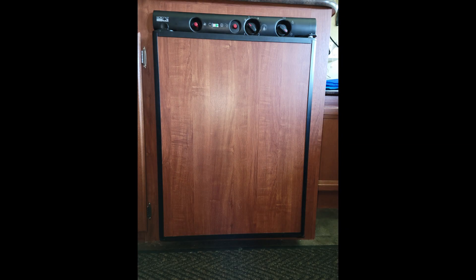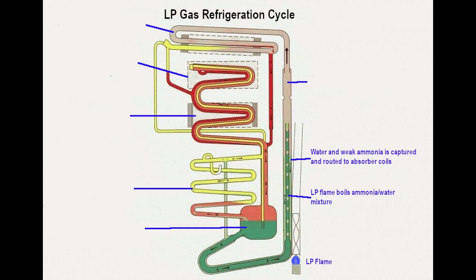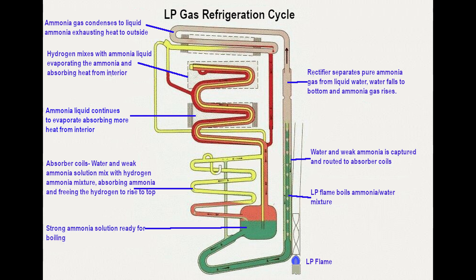Now let's get started. The refrigerator in my travel trailer can operate on either 110-volt AC or propane gas. It seems counterintuitive that you burn gas to keep things cold, but that's what makes the absorption refrigerator so special. The sealed refrigeration system is filled with a pressurized mixture of distilled water, ammonia, hydrogen, and sodium chromate. The heat from the burning propane is used to boil off ammonia from the water, where it circulates through a labyrinth of tubes, tanks, and heat exchangers, mixing with hydrogen while both absorbing and releasing heat. I'll put a link in the description to a couple of videos that explain absorption refrigeration if you're interested.